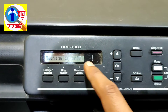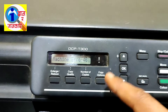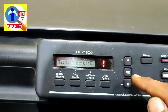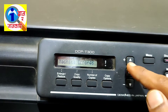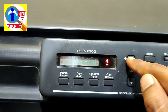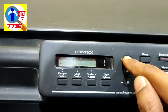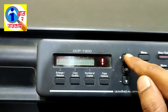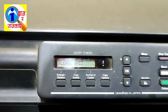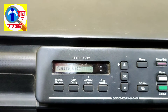Now again press the Plus button until it shows three. Okay, it has shown three — press OK. Now Machine Error 46 has occurred. To restart the machine and remove Error 46, you have to press 99. Press the Plus button to make it nine nine, then press OK to restart the machine.